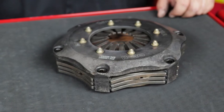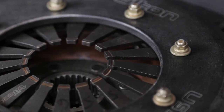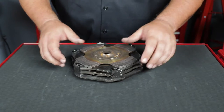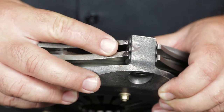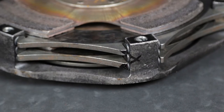The clutch assembly should be checked for any physical damage during removal of the components. Keep on the lookout for any broken pieces or foreign objects in the area. Before removing any parts from the clutch, note the alignment marks of the clutch cover, floater plates, and pressure plate. Keeping these marks lined up will ensure that the clutch's factory balance is maintained and that the floater plates are not accidentally flipped over.